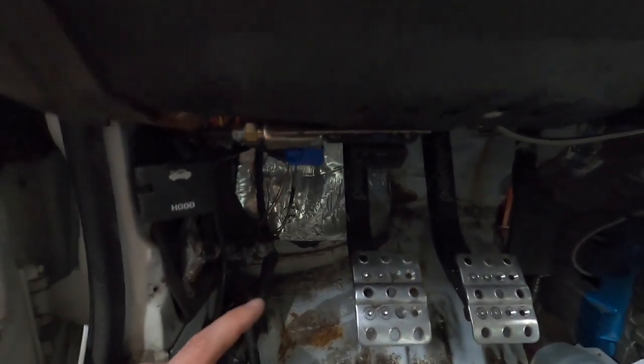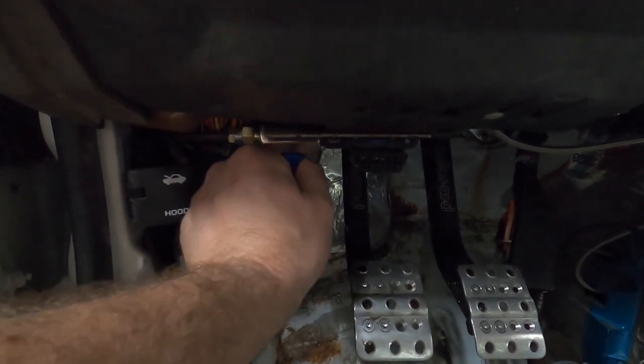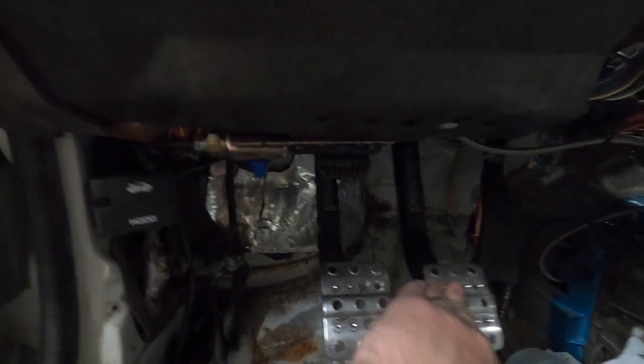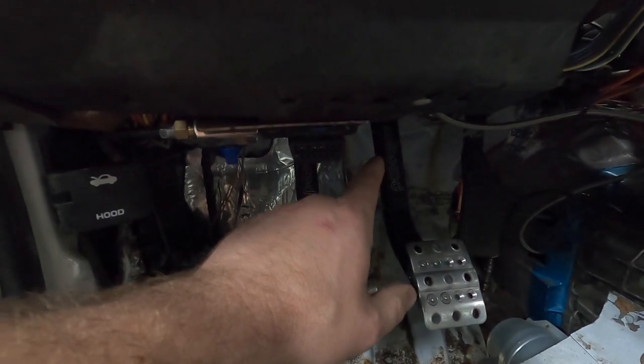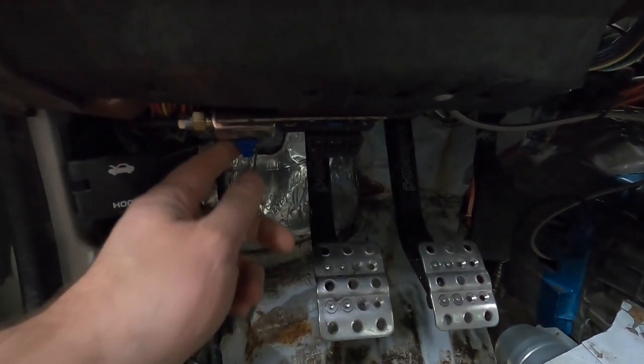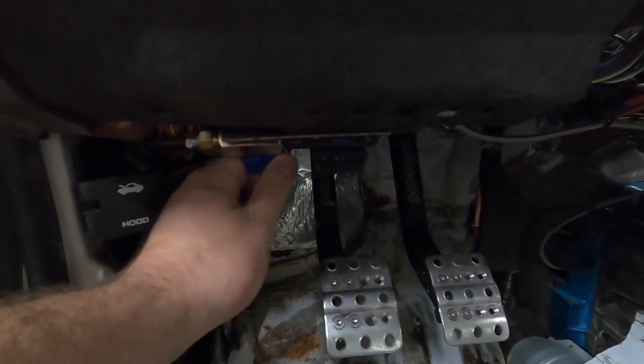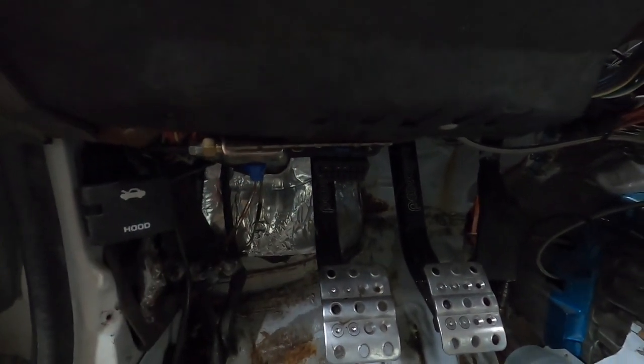I did this backwards so that this is in the rear brakes here, and what I can do is shut this off, and then when you hit the brake pedal, all you have is front brakes because you have no fluid flow to the rear. And the other thing it lets me do, I did this as a ball valve instead of a 12-volt solenoid because this is also my parking brake now.